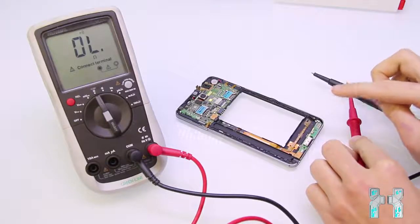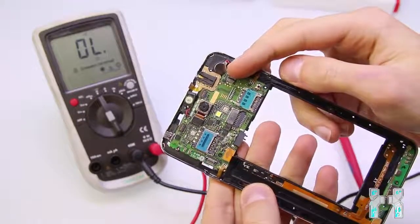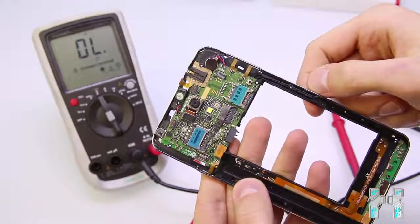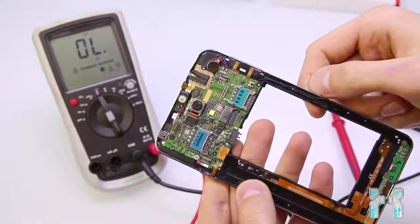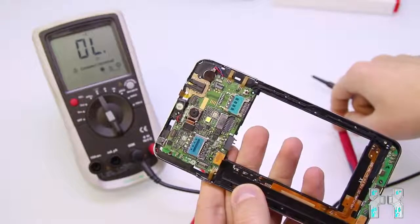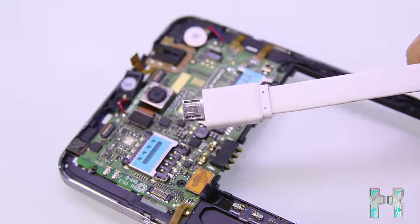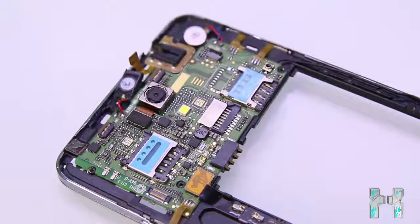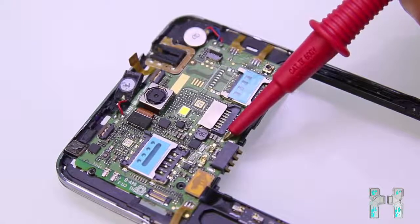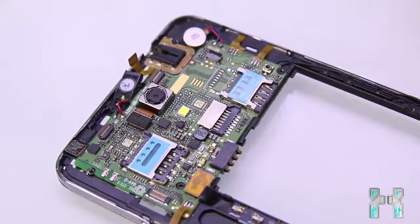We have to find the test point on the mainboard and bridge it with ground. Connect the phone to the computer via USB so you can see in Device Manager whether you've hit the correct point — when the MTK USB VCOM port pops up, you know it's correct. Find the ground point labeled GND. Do not connect anything labeled 'plus' or 'VBAT' to ground, because that will short something. Just check all the unlabeled points and brute-force which one is the test point by connecting each one to ground one at a time.